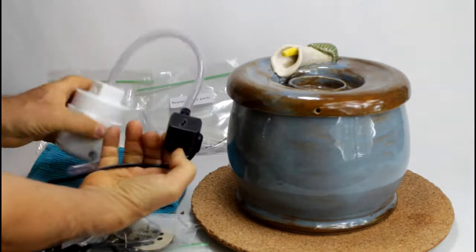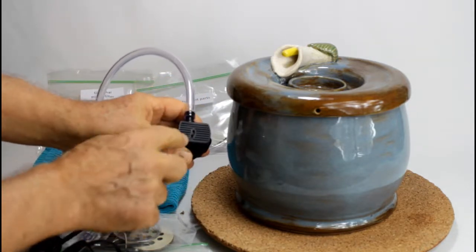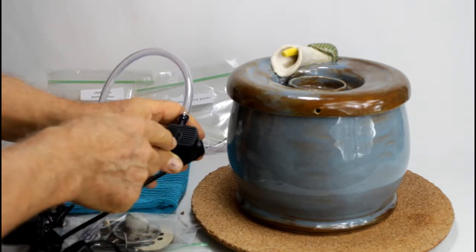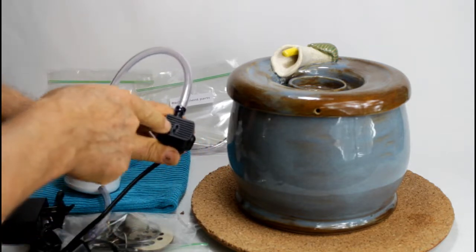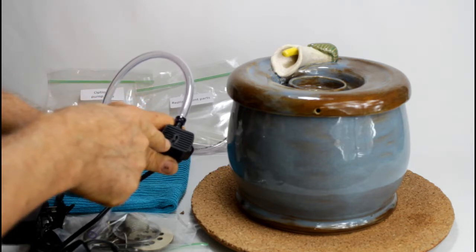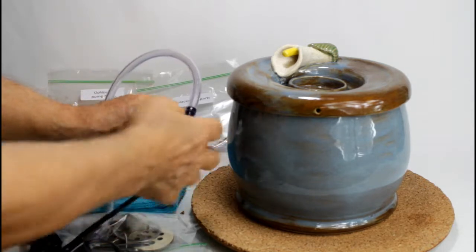The pump has a flow control valve. Make sure it's set to plus. When you clean the fountain, and after cleaning you experience a weak flow, check first if the flow control is set to plus or if it's accidentally somewhere close to minus.